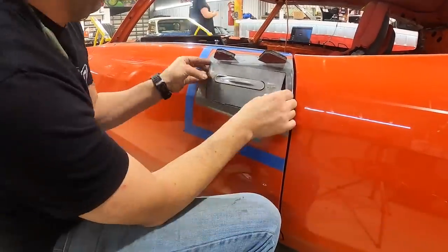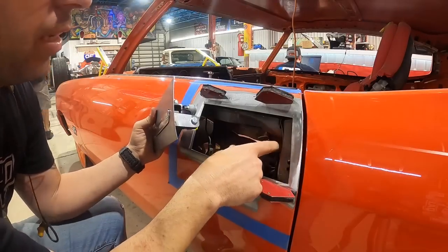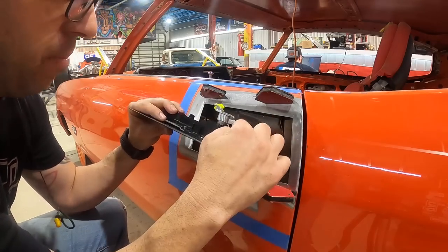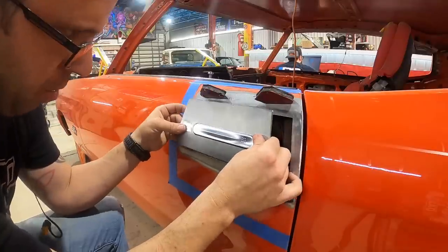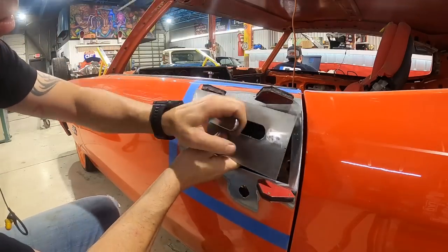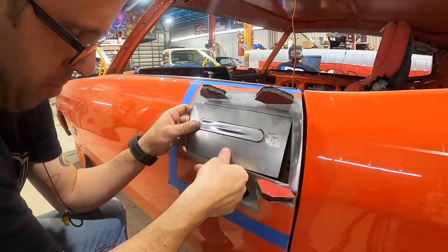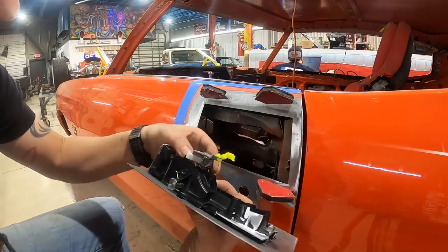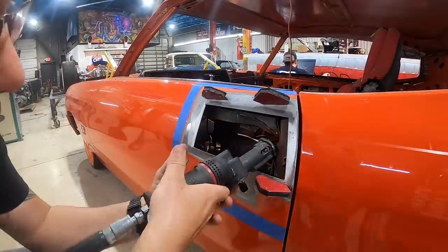It looks like the door handle mechanism on the back side here hits the inner structure which goes inside of the actual door jamb — I should have paid more attention to that. These handles normally aim backwards, so when you grab the door handle you pull it like this and pull the door open. So I could flip it back around to make that work and just make some linkage to work with this normal movement. In order to do that I'm going to have to cut this structure away to fit this inside.